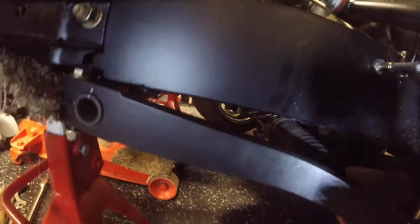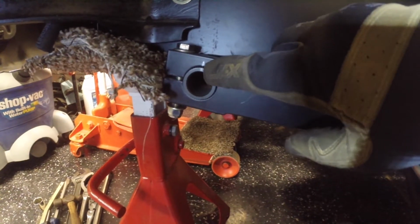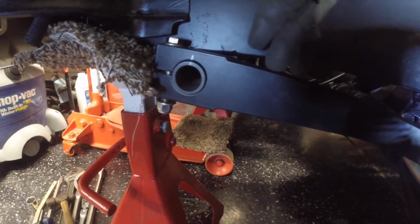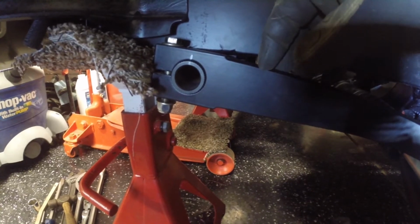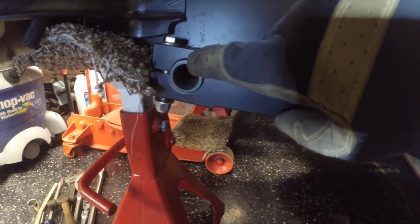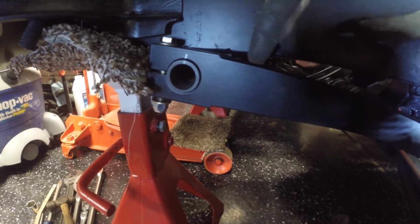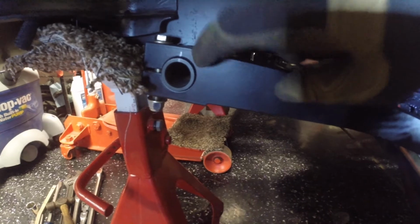So the arm is installed in the standard spot, and one thing I do, just as a little tip, is with these 3-piece bars, I put a little Sharpie mark on there. When you get these things clocked, you want to be able to take them on and off and make sure when you put it back on, you have it phased with the other side. So just put a little match mark on there, lining up a spline with a mark on the arm. That way you ensure that you get the arm back in the same spot when you took it off. That's just a little tip.